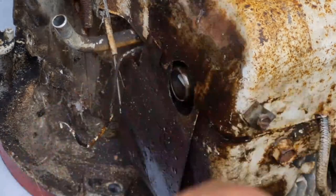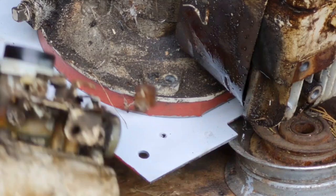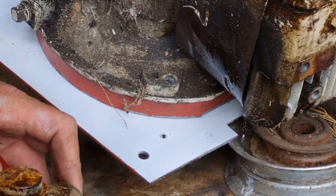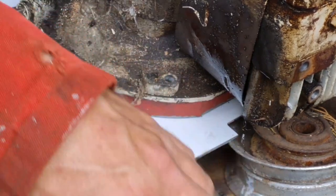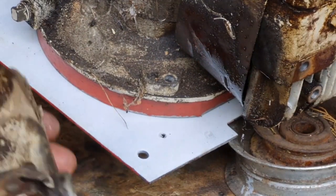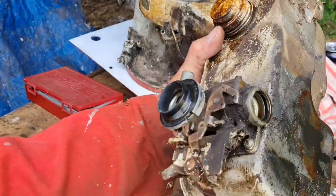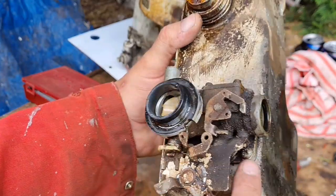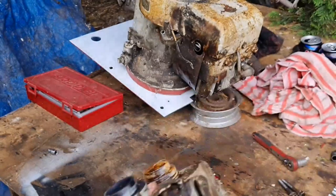All right, we are finished with this engine for the minute. Move him out the way. The bit we want is this carb. Now then, there's four screws we've got to get out. There's two little quarter drives in here, look. The only reason you've got to take this bracket off is there's a screw in there. Hang about, let me zoom out a bit. There we go. There's a screw in here we need to get to, and you can't get to it because you've got to take this bracket off, which is two little quarters in there, look.